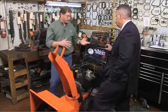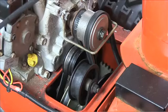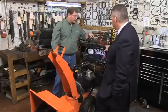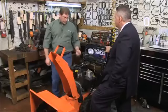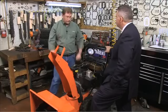The snow is flying, it's time for me to start snow blowing. What do I need to check before I use it for the first time this season? Go back through your owner's manual, make sure you did the proper maintenance. One thing to check when taking it out is the belts — take the belt cover off, check the belt tension, make sure the belts are going to last the year. It's also a good time to check for critters — make sure there are no mouse nests and debris inside. Check your controls, make sure they're working freely. Check your engine oil level and the auger gearbox, make sure they're both holding oil. Then turn on the fuel supply to the carburetor and it should start right up.